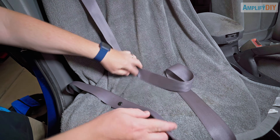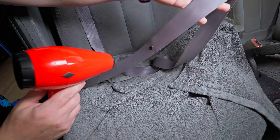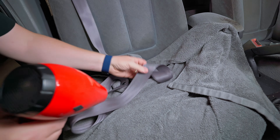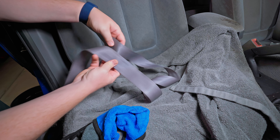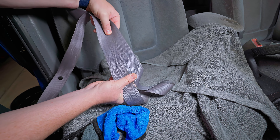So we're going to make sure we dry it out. There are a couple of different ways you can do this. The slow but easy way is to just leave this seatbelt stretched out like this and park it somewhere sunny for an afternoon. However, if you're in a little bit of a hurry, you can also just use a blow dryer on a lower setting so you don't burn your hands, and just blow dry it until it's completely dry. The blow drying is all done. This seatbelt is nice and dry and very flexible again, and it looks nice and clean.